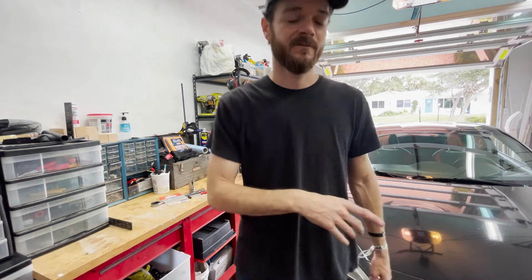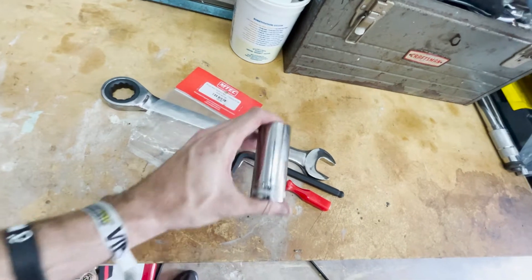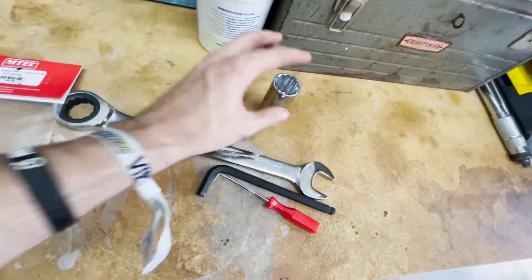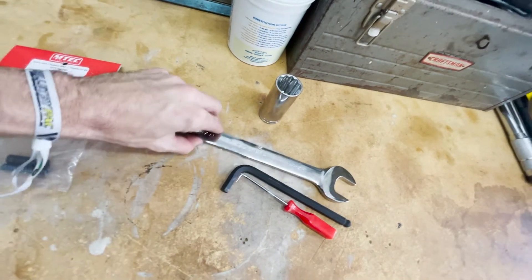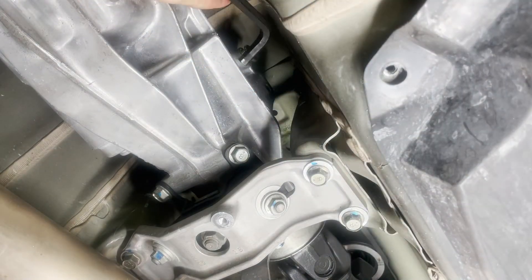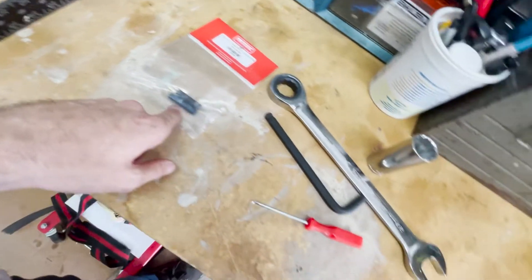Let me show you why I couldn't install it in the first place. Originally, I set out with Speed Factory's video in mind — they had a long 27mm socket and I figured I could get away with that. Turns out you can't; I'm not sure how they got it off without some kind of wrench because you just cannot get in there past a certain point. We're going to try it with a wrench today. For the side already installed, you can use a 10mm allen — I managed to break it by hand — then a little pick to grab the spring out because it's kind of annoying. So we're going to get the car in the air and do the other side.